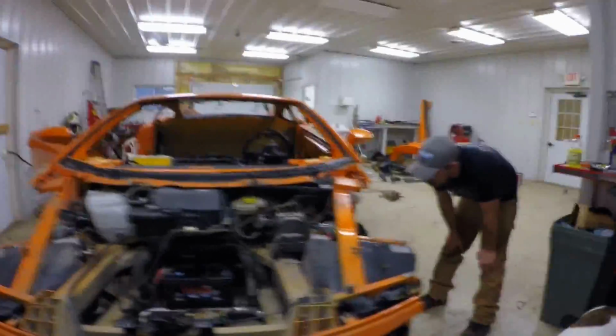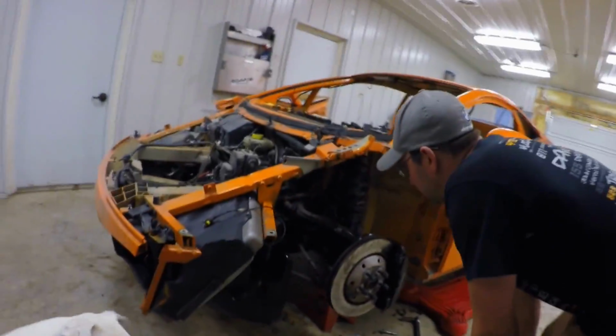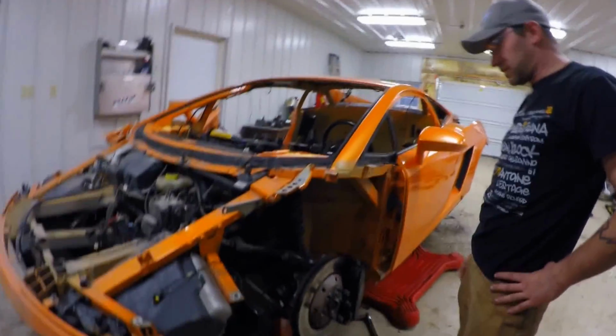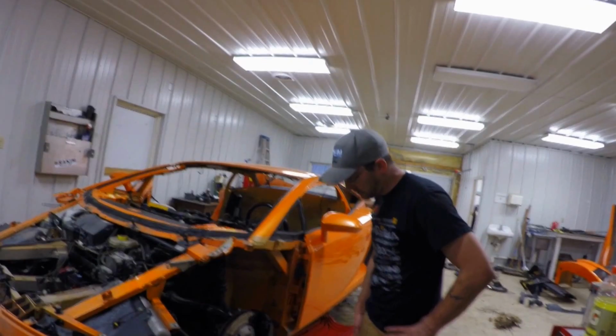They relocated the windshield so they could put a bigger turret on the top there for the suspension. All right. That'd be cool, right, Charlie? These control arms are just cast aluminum. I don't know how well they'll hold up in the rally. They won't. But you could go to a tubular DOM control arm with Heim joints inner and outer on them. Yeah, I think full clip.